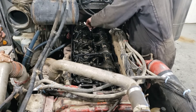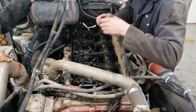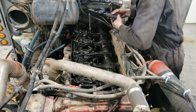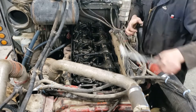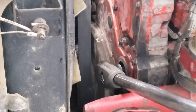14 thousandths for the longer intake rocker and 27 thousandths for the shorter exhaust rocker — again just a slight drag on the feeler gauge, then tighten the jam nut. Do that for both exhaust and intake, then grab the inch-pounds torque wrench, back off the jam nut on the injector adjuster, tighten it to 71 inch-pounds, and tighten the jam nut up.